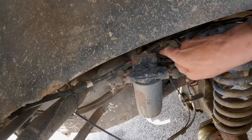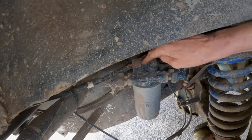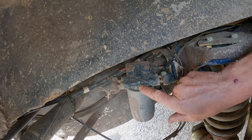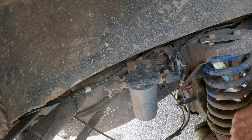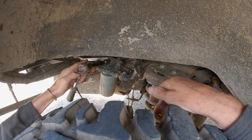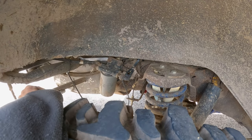So, as you probably know, there's the filter head. There's these two bolts here, that one and that one to take out, and the whole thing will fall off. And then these are these horrible push fits. So I think what I'm gonna do is take these two off before I take these off, so I don't get fuel everywhere. We'll take the whole thing off, bolt the new one up, and then take the pipes off and pop them on, I think. Okay, so start by taking these two bolts out, which hopefully won't be too bad. Eesh, doesn't want to move, does it?